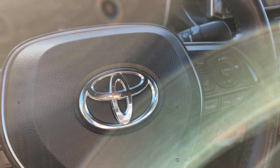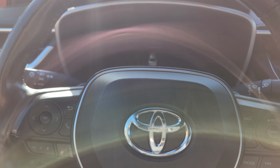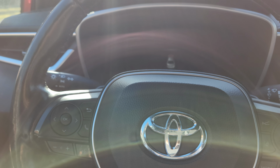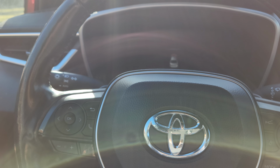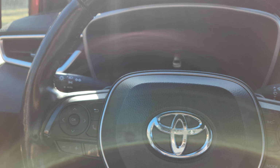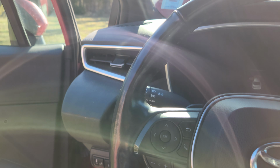and then you'll know your emergency parking brake is fully disengaged so that you can press the piston back into the caliper once you've taken your brakes off. And you have to do this because you cannot press the piston back in with the emergency brake. It is way stronger than you are and you'll damage it. And even if you do succeed, when you go to use it again, it won't know what's going on and it won't work properly. So you have to disengage it completely. And I'll just pause this while I set up.